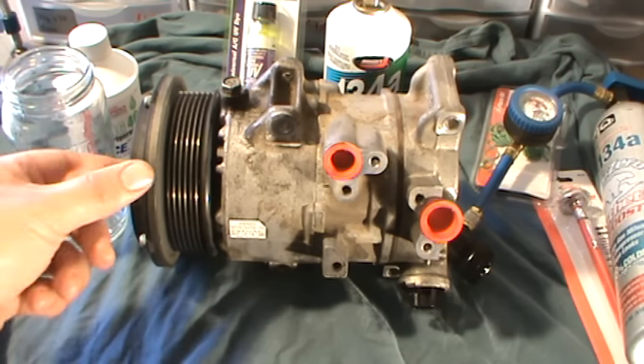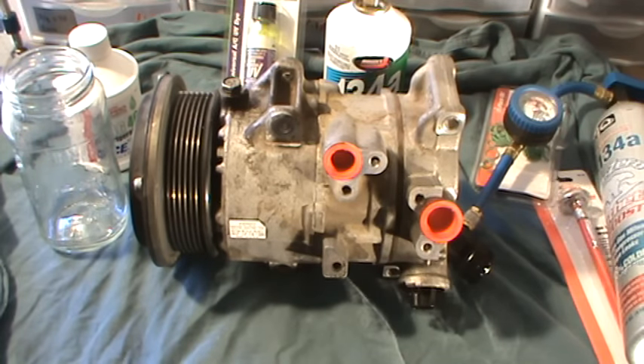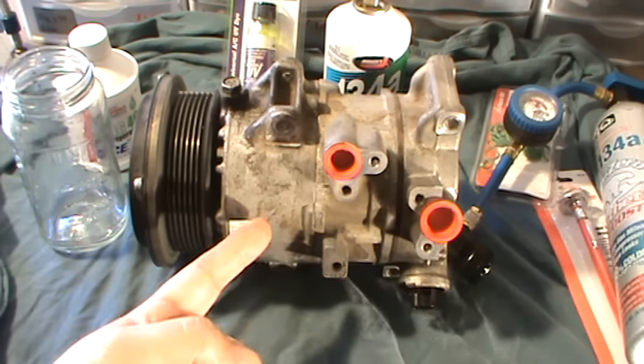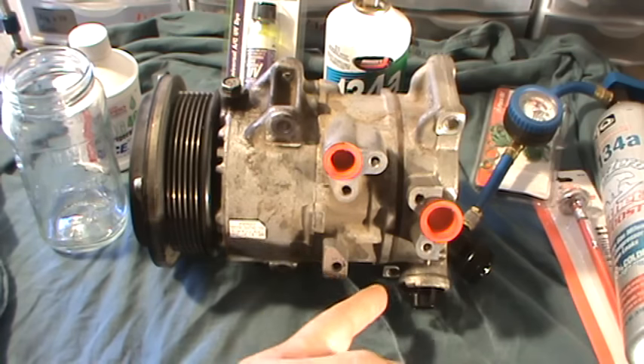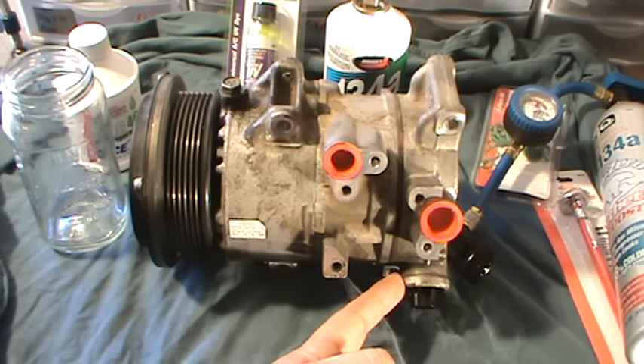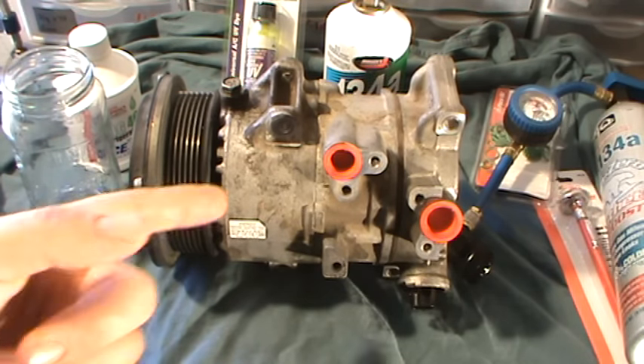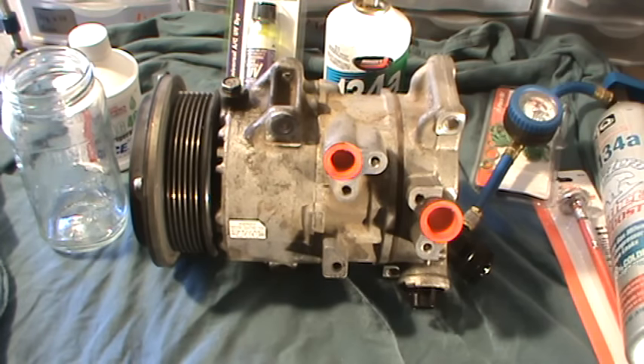It shows you how it works — it's not like the regular clutch type. You can see there's no electrical going right here; it goes right here. This is a valve. And another thing Eric O was saying is these go out a lot. But this compressor probably has 165,000 to 170,000 miles on it. This part right here is about $50 to $60 just for that electrical part that goes in here. Changing this out, you still have to recover the system and do everything else. To me, it's better just to have a rebuilt one for basically triple the price, because you're going to have to recover the refrigerant, vacuum, and refill anyway — and in this case it wouldn't have worked because that wasn't the problem. The compressor itself just wasn't working. Anyway, thanks for watching — comment, rate, subscribe.